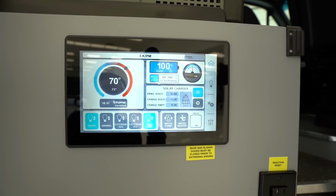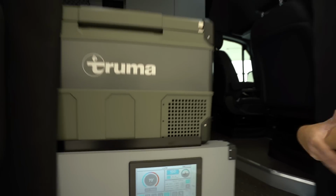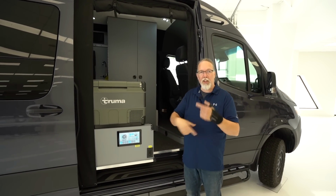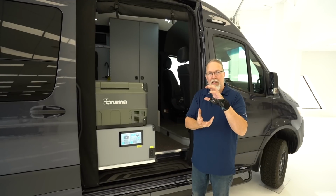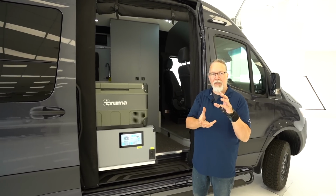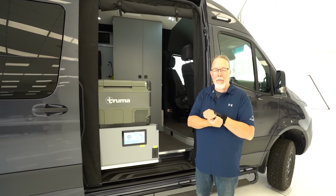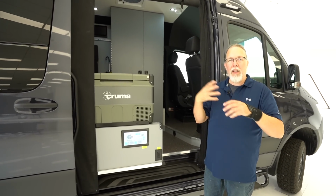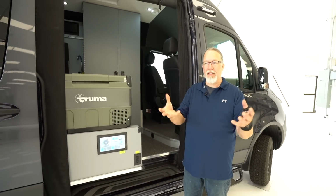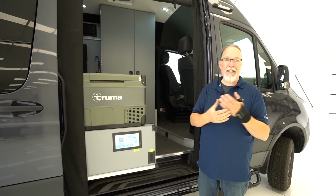Okay, so like I said, once you've done that on, the pump inside the water heater will start up, and it'll start circulating the water out to the taps, heating up the little 1.5 liter reservoir that we drained on the back side when we were showing that yellow tab. It'll keep that going and run any water out to the taps so that when you turn on a tap, you will have water almost instantly.